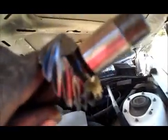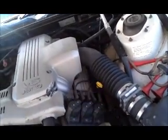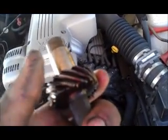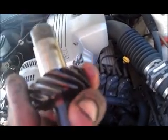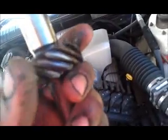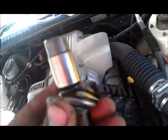Here's the old distributor drive shaft. And you can see they're razor thin. It's sheared, but the other one had sheared completely clean off. At least this one, the driver of the car, she was good enough. As soon as it backfired, she realised and just took it easy on it and drove it home, just being easy on it, and managed to preserve it and got home.